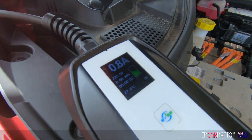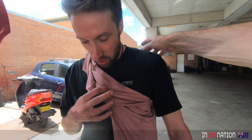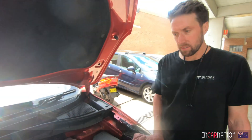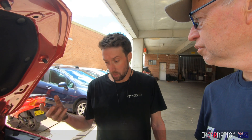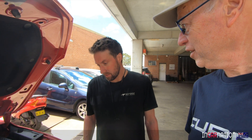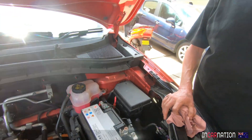It made the noise - it's charging now. So it is bad news: we need the ECU. Even if we use the batteries standalone, we still need an independent brain to monitor temperature, switch on cooling fans and cooling pumps, know when it's charging and when to turn things on. The ECU is tied to the motor, so if we don't want the motor we could have sold it - but you can't sell it without the ECU.